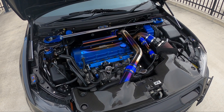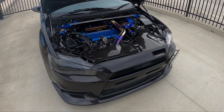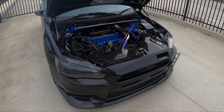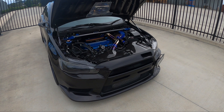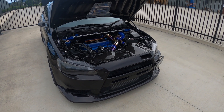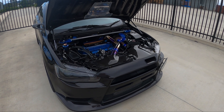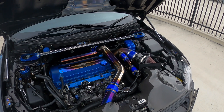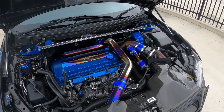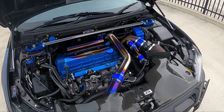That's where I basically have my car and I'm absolutely loving it. Also at that point you're going to want to consider getting new clutches for the SST, or a new clutch for a manual, because at that sort of power figure it's about where the factory stuff is going to start to die on you. So be prepared to do clutches at that point.